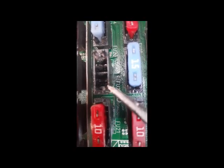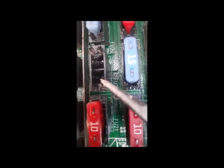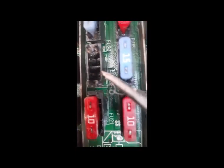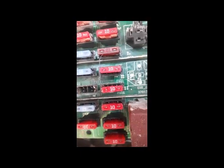I will push this area so that if it becomes a little tight, our fuse will fit properly and will not be loose. You can see one strip is a little narrow and one is widened. I'm going to make the wide strip narrow so the fuse becomes a tight fit. The stitches on the back side are okay — only due to burning or sparking these strips have opened up and the fuse became loose. That was the only problem.